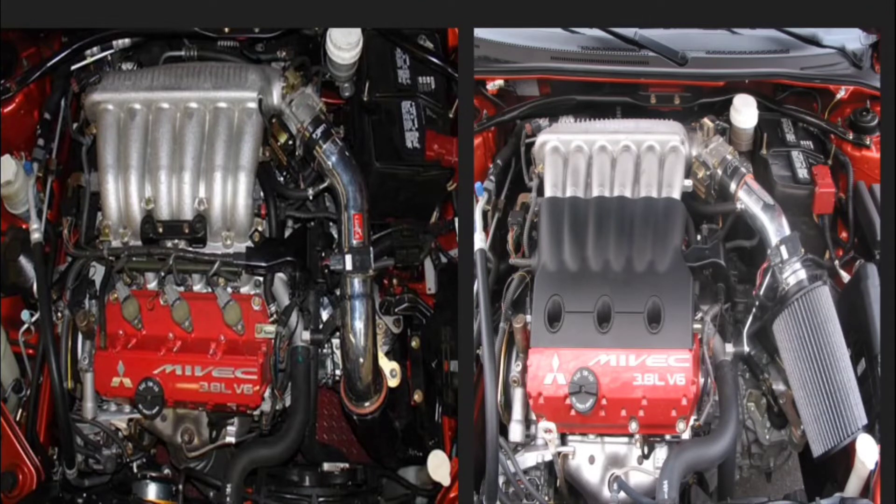The problem with the 4G Eclipse and the short ram intake — as you can see right here on the right side — is that we don't have anything to protect it right next to the engine. Usually, if you have a short ram intake, you want to have a little cover here to at least block out the heat a little bit. Ultimately, it's still going to get hot in there. As soon as it heats up and you step on the gas, all that hot air is going to go straight into that air filter and right back into that engine, and you're actually losing a lot of horsepower.